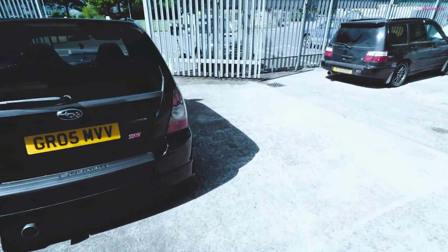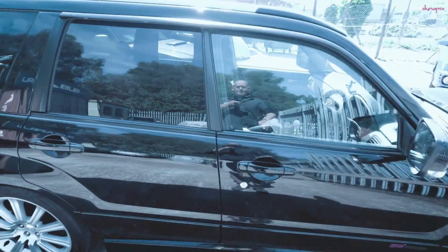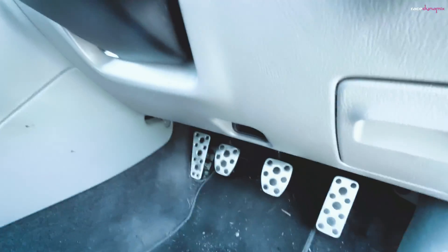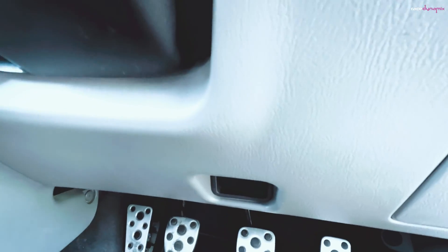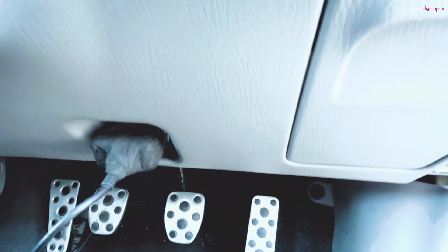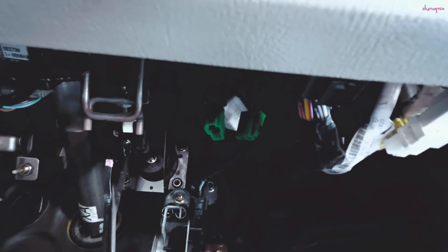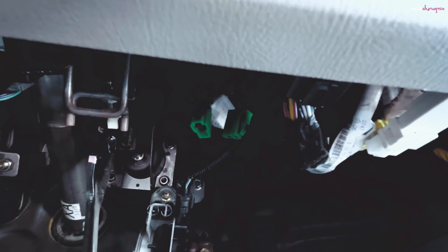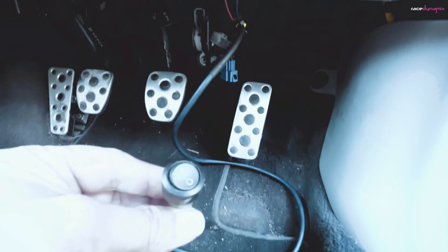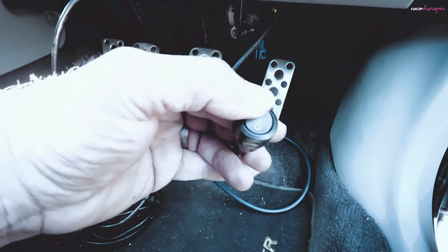Summer has actually arrived here in Bournemouth finally, so I've decided to clean the car — looking nice and shiny today. Laptop on the seat. We want to be looking for the OBD plug which is here, and I'll plug my cable into that. The green test mode connectors are up under the dashboard up here. I've got a switch cable in here, and the other end of that cable has a little on/off switch that just tells me when the test mode connectors are joined.